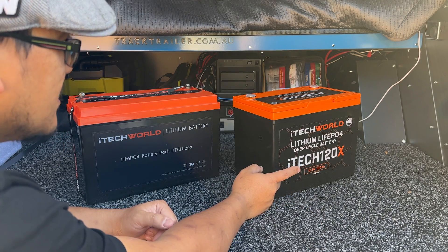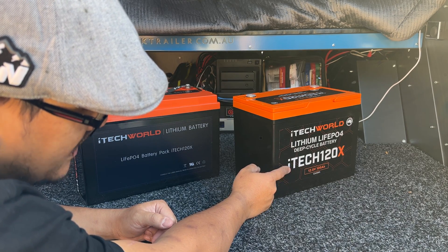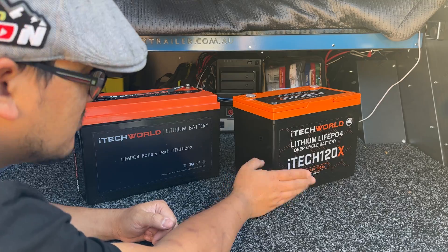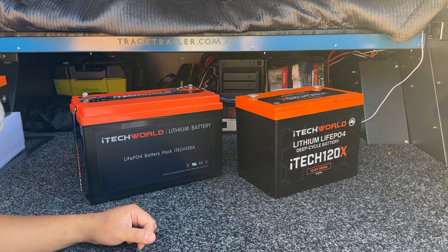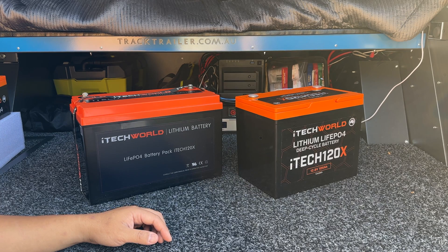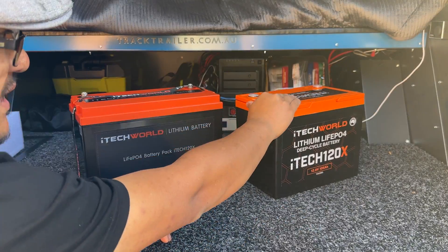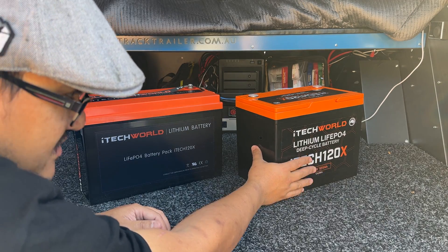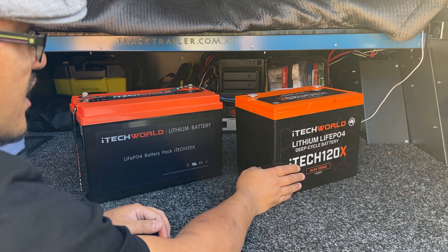This is really right in the perfect market for many people, especially people converting their old camper trailer AGM battery to lithium, because these batteries also work on your standard non-lithium DC to DC chargers — and I have tested that. They get to around about 96% full charge. They do slowly charge up over a long duration of time, but even if you only get 95% capacity of your 105 amp hours out of this, it's still better than an AGM and it'll last triple the life of an AGM.